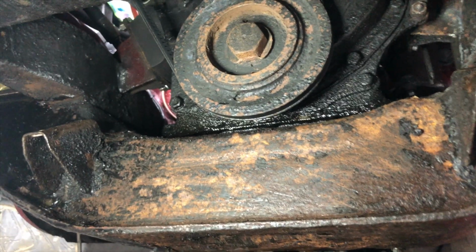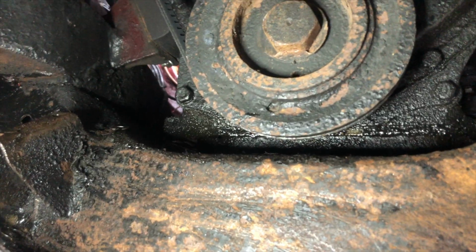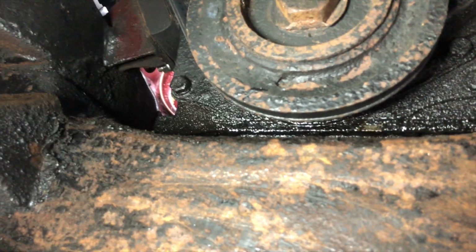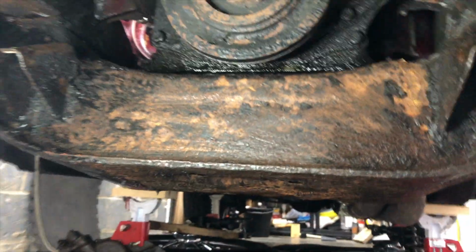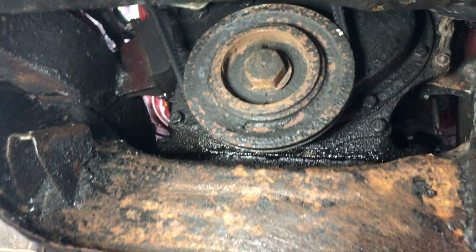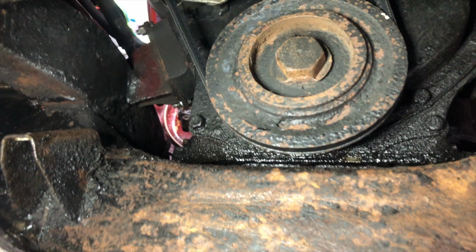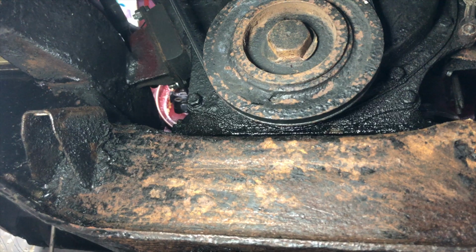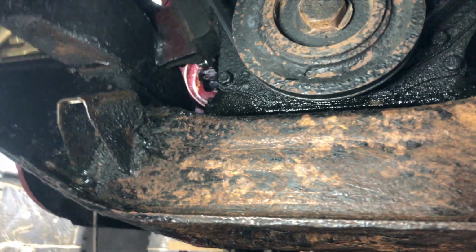Well, that's the steering rack removed and it's gaining more and more space, but I just want to highlight, I believe I've got a leak from the crankshaft seal, and it's getting to the point now where once I remove the cross member, I'm going to have enough space to actually remove the pulley, if I just tilt upwards the bottom of the radiator. So my question is, can I actually renew the seal before I replace the cross member? Because that'd be two jobs in one.